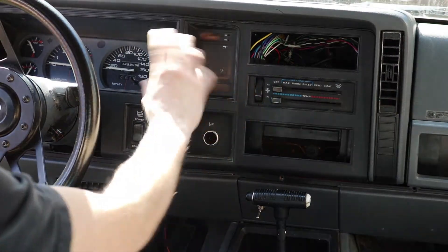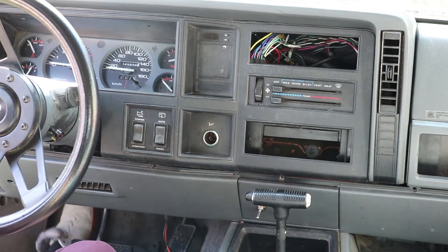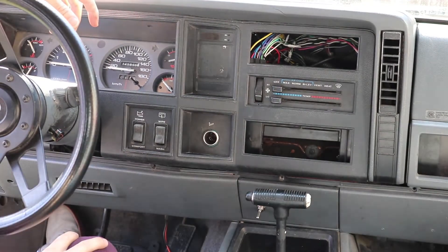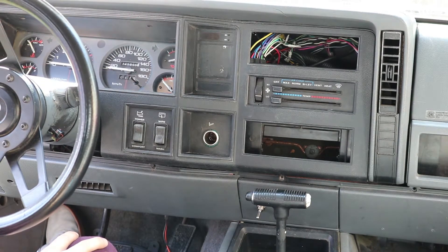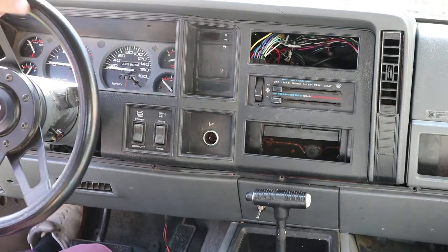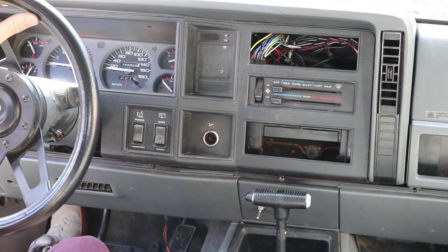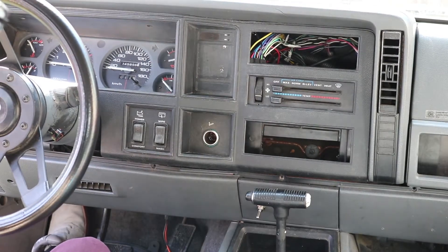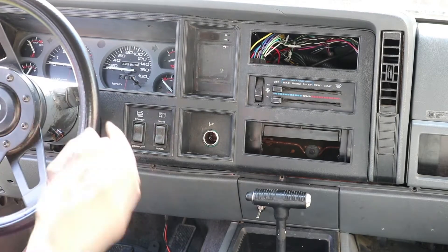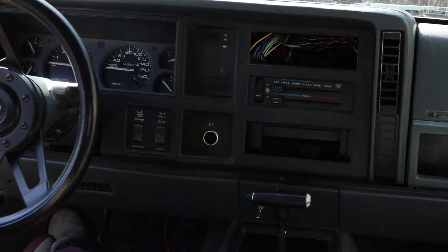Fixed the dash lights - all the bulbs are working. I had a bunch of extra bulbs from previous salvaging, so replaced all the dash bulbs. Got the cigarette lighter working as well - there were a couple of bad connections back there and it was pretty intermittent, but now I can charge my phone, iPad, navigation device, whatever I need. Clock's working now too - it was just unplugged, that's all it was. Really coming together. Got the blend door working again since it wasn't even attached.